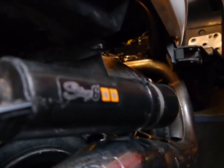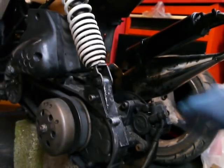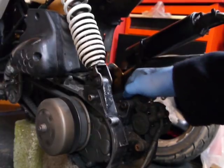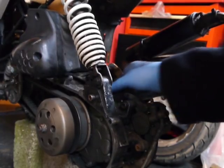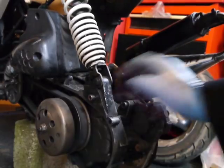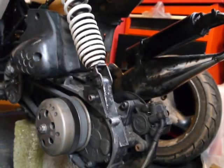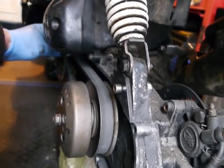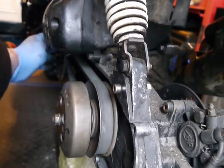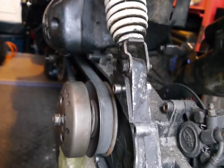The list of jobs for this bike just keeps going on. Back wheel off, cover off — and guess what, still this horrible noise. I don't think it's the gearbox. I actually think it's the clutch. Let's get that off, shall we? It wouldn't do it when the engine was running. See, it only rubs the inside bit — doesn't actually turn the back wheel. Let's get this off and have a look.